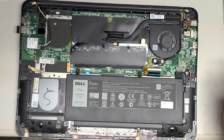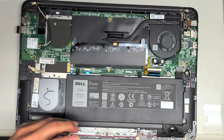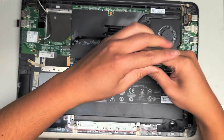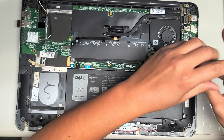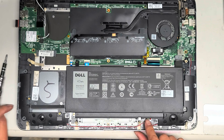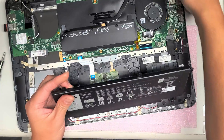Let me take out the battery just to show you. Take out this screw here, one down here, and another one up here. You've got three along the top and two on the bottom corners. It looks like it's also held in with a cable. The cable comes out from the bottom and curves around — and if you look underneath, it's actually held down with some adhesive.